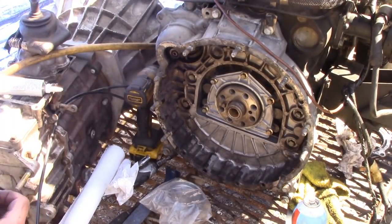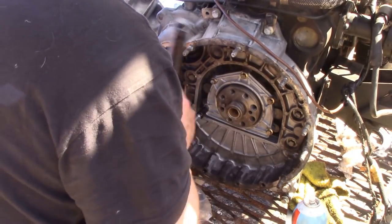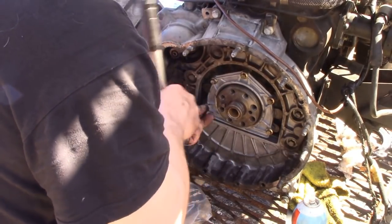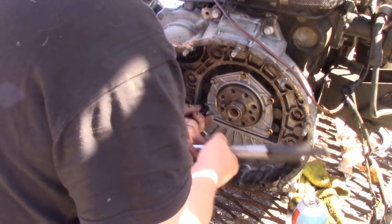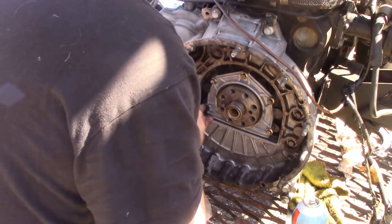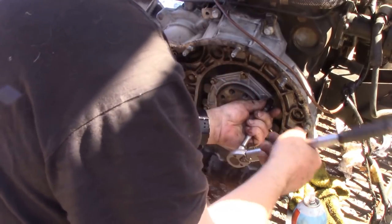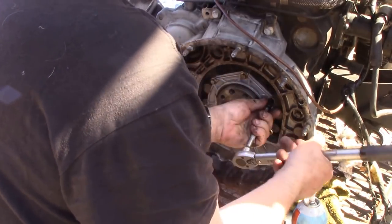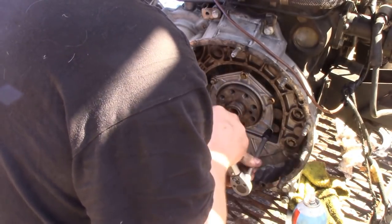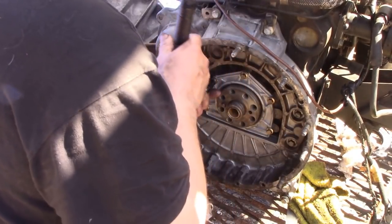I'll give you a ratchet. Oh, no, it's all right. I've got the torque wrench here. Okay. I think what they've done is they've got silicone everywhere on it. Yep. You're way too much. Oh yeah. Sometimes sealers like that can actually hinder you. They don't actually help. No. Then if you don't know how to do it, that's the main thing. Well, they just think because it hadn't got a gasket. See, in the old days they used to put a gasket on these. Uh-huh. Not now. They just bring them straight on. So we'll just nip the bolts up.